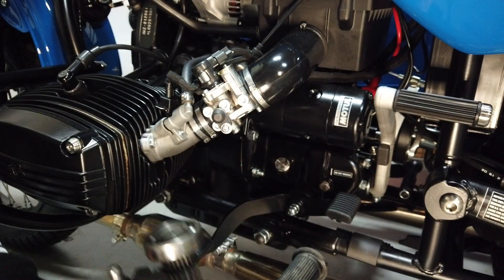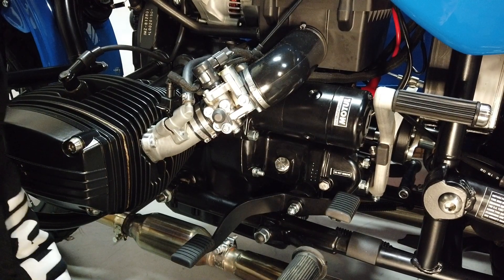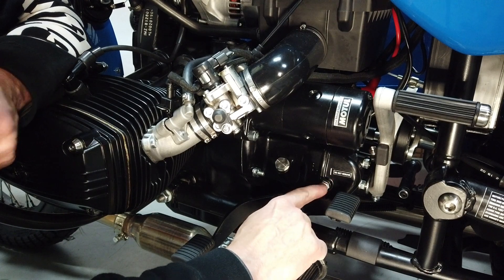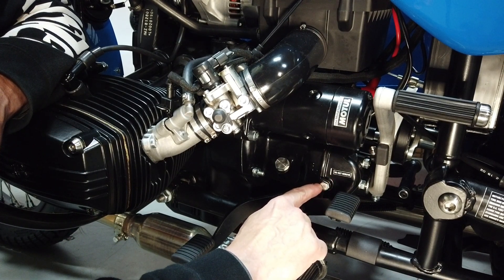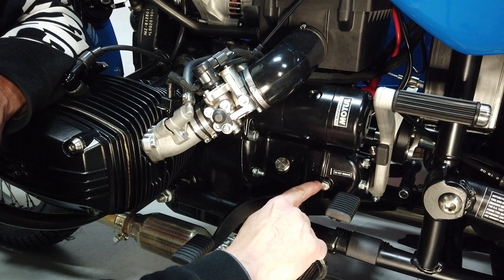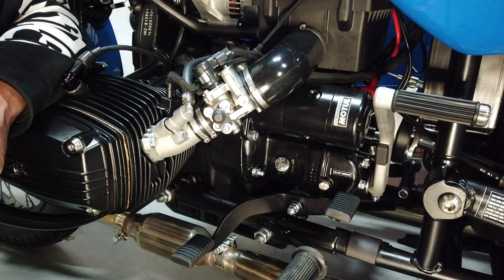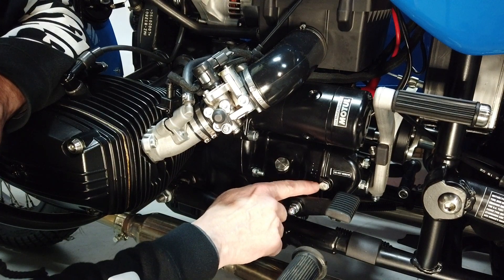That's why I wanted to point it out so you didn't make that mistake, because on some of the early import bikes — and even still today — a lot of times there'll be a bolt similar to that which is actually a viewing window to make sure that your gearbox or motor oil is at the right level. That's not the case on your Ural motorcycles, so do not remove that bolt.